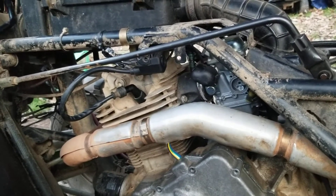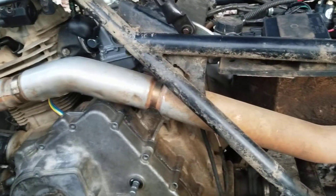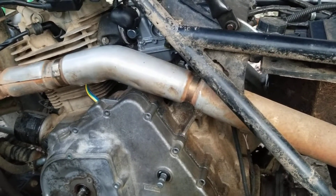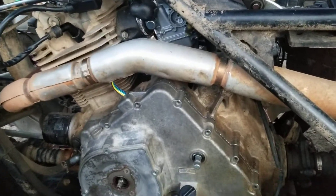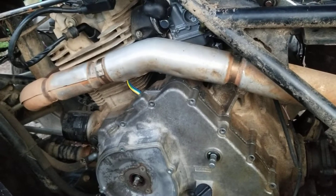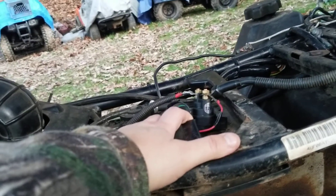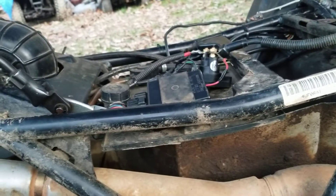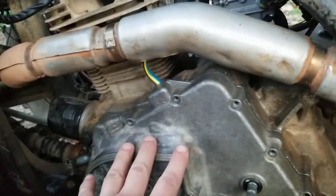Since then I haven't got this four-wheeler to run. We hooked a regular battery up to it to make sure we had enough cranking amps, trying to problem-solve why it wasn't starting. In between waiting on parts — with all the shipping delays this summer — it took a while. I couldn't remember how certain connections went back, so I had a neighbor helping me. We had a ground wire going to the solenoid hooked up wrong, and the wires got really hot, so we stopped.